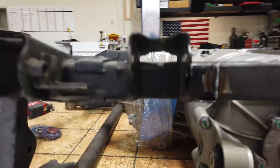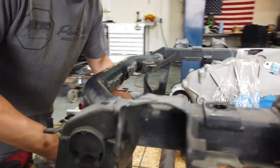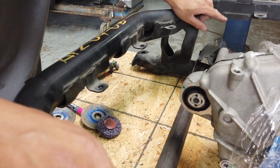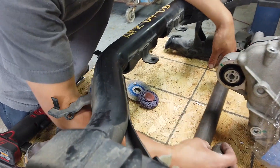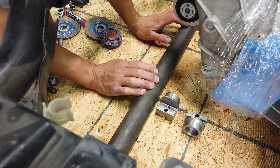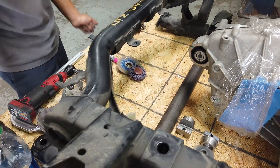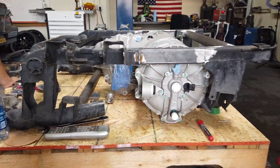We were talking about this front bar. Chris, what were your plans for the front bar? I'm just going to tie into these little control arm mounts right here and then triangulate it from the top to the bottom. It'll have these two connectors in between, so whenever you plan to pull the motor you can drop the whole thing without it getting in the way. I'm liking what I'm seeing here.